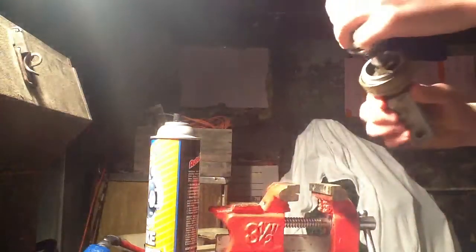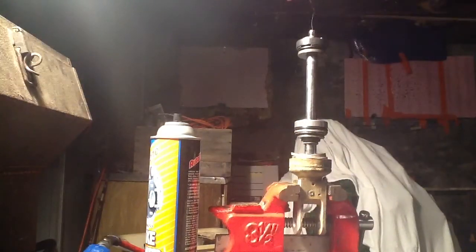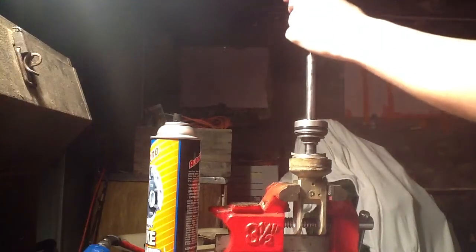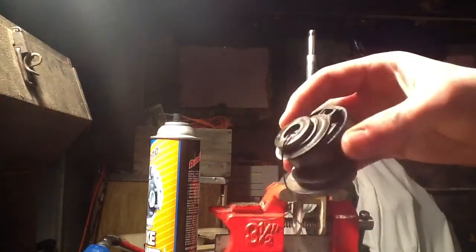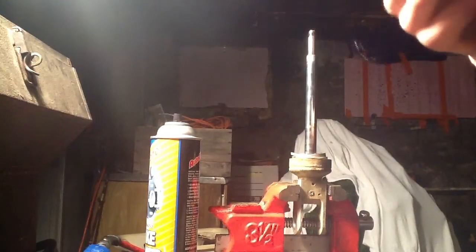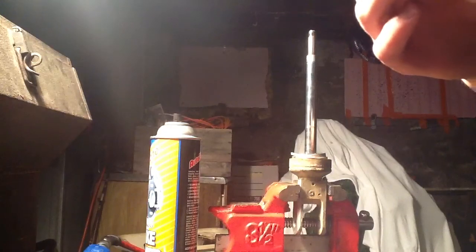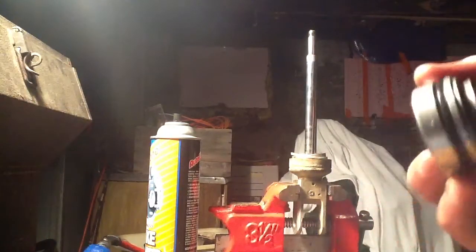So let's get to getting this back together. We get our wire back in that little hole, and now you just pull everything up onto that wire — it comes right off. Take that wire, twist it, and now you know exactly how everything came off — no guesswork, no losing all those little washers. This is the top because it's got a thick washer, then it's the bottom. Pretty simple. Next, pull our head seal — it just comes right off. Stock head seal — whoever rebuilt this just had new seals put in from C-Cycle. They look like C-Cycle seals to me on a rebuilt stock head seal.